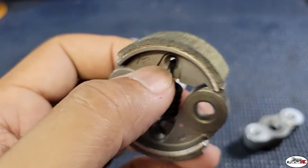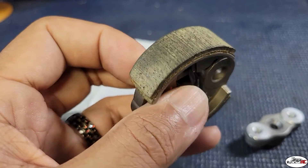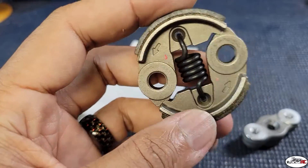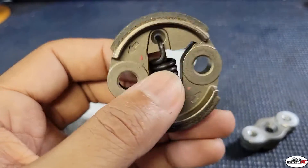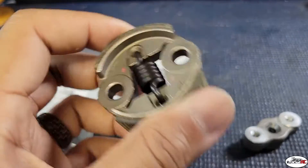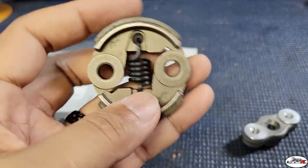You can play around with this — you can drill these out or put a different spring on, take some of the pad material off, and change all your clutch engagement characteristics. Like I said, this comes into play a lot with drag racing and course racing. For bashing, you can pretty much swap the spring and run with it.